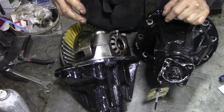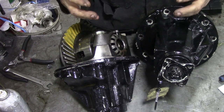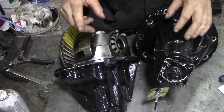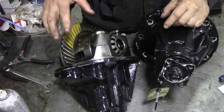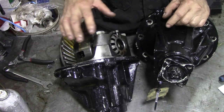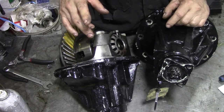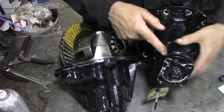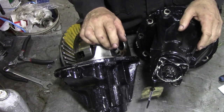While we're talking about axles and leaks, one thing you should know is that when you've got gears running, like down here, when the gear is on it creates a lot of foam and a lot of pressure in your axles. This is why they put breathers on - to let the air breathe in and out, because the oil is foaming, making air bubbles and pockets. It's most important to let the air in and out of the casing, because if the breather is blocked, that pressure has nowhere else to go but outside of the seal here or your hub seals. It's as simple as that.